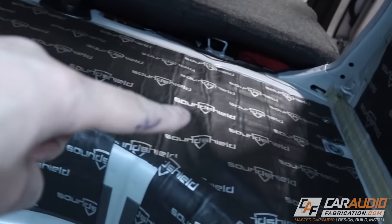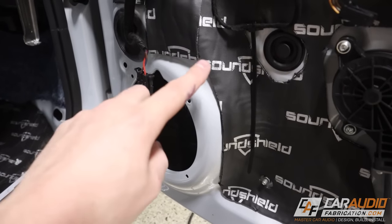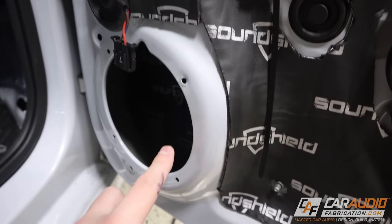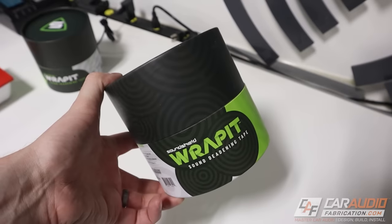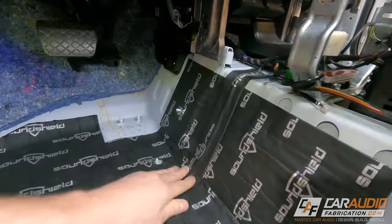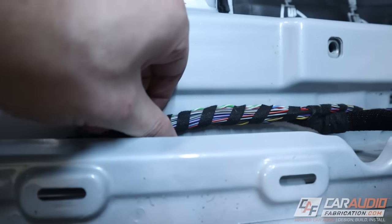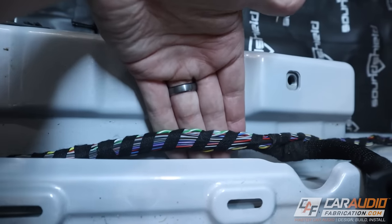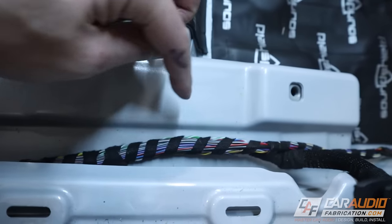The main area in the trunk that needed it is the floor, which tends to resonate, and I also put some up on the rear deck. I want to make sure that I put some around the speaker location in close proximity to where the speaker actually is, but I'm holding off because I still need to drill out holes, add threaded rivets, and make custom speaker adapters. As for the Wrap It tape — this is just the closed cell foam with adhesive — in areas where a wire bundle goes quite a span without a fastener tying it to the vehicle, we can put it underneath to prevent the wire bundle from vibrating against the panel without adding much thickness or messing with fitment.